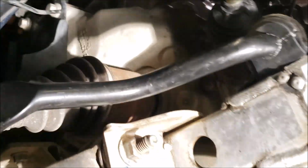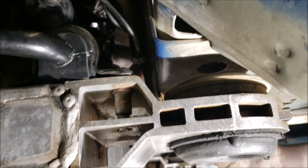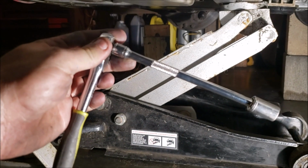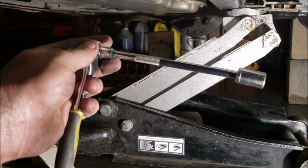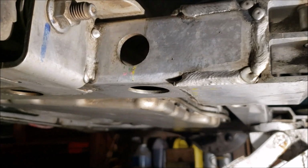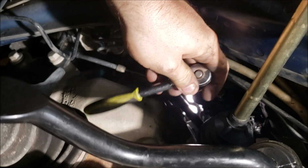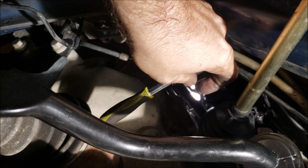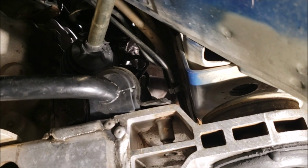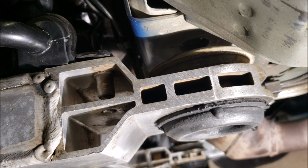But what worked perfect for me, and again, that was at that 1 3/4 inches range, was to just use a 6-inch extension, 1/4 inch ratchet, and my 11mm 1/4 inch socket. And I mean, you can kind of get an idea. It gives you room. I'm on it right now. It's actually easier than taking it off, because taking it off, I didn't know how much give it was going to have. So this was all compressed all the way up, and it was even tighter.